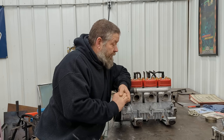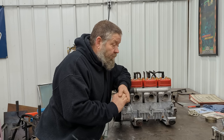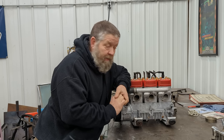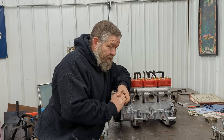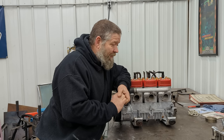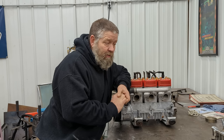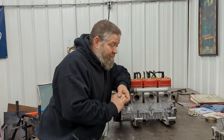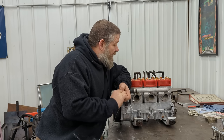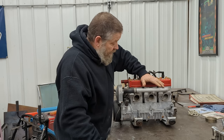It's hard telling what caused so many cylinders to fail on these RXLs — maybe issues in the computer system, bad fuel, or lack of letting them warm up. With EFI they kind of self-correct, so you can run them right away. We have an RXL right now, and if you don't let it warm up a little bit, you can't really give it gas right away. You can definitely ride them sooner than a carbed sled, but maybe people just never really let them warm up long enough.